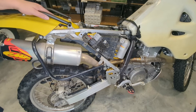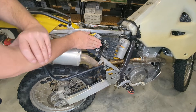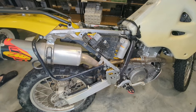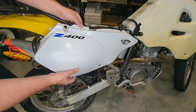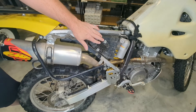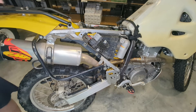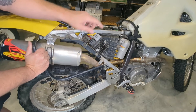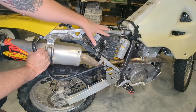We'll start by showing you where the regulator is mounted. This was a great location, as long as you don't mind doing a little bit of work to drill through your airbox. We mounted the regulator here on the right side of the airbox and it fits completely behind your side cover — the side cover has enough of a bulge that it'll go over the regulator. It is a tight fit and the regulator will rub a little on the side cover, but it lets you mount the regulator in a nice location away from excessive mud and water.